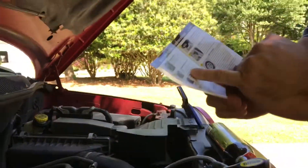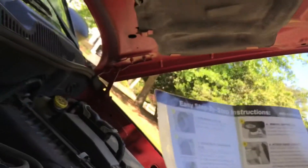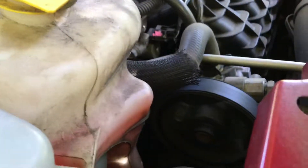The thing we're looking for right now is to determine if the compressor is on. With the AC on, determine if the compressor clutch is engaged and cycled on. So down here, the compressor clutch should be spinning. It looks like it is, so I think we are engaged — that's good news.